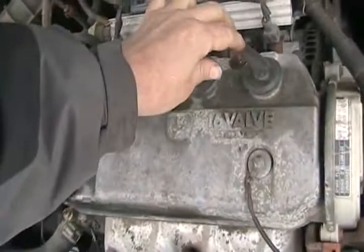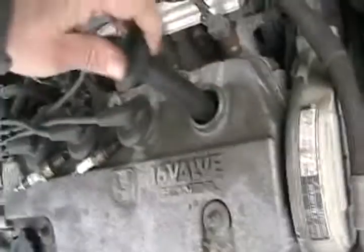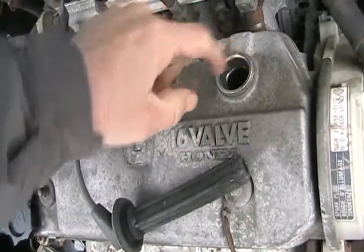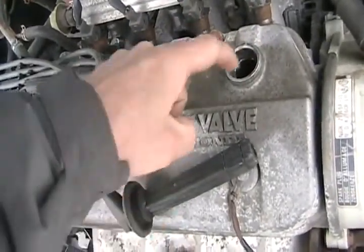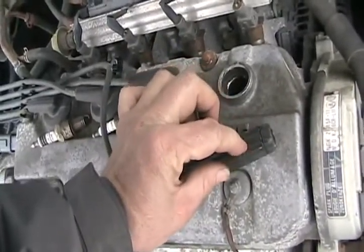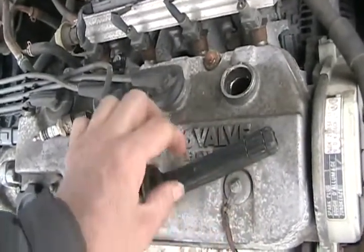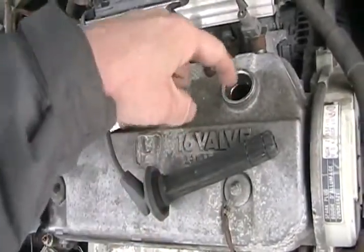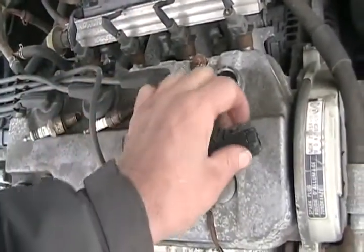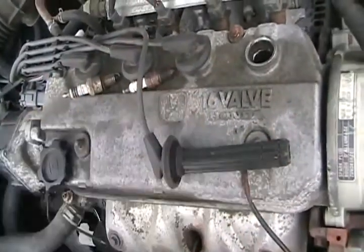On cars with semi-hemispherical or 16-valve engines where the spark plug wires are in the middle of the rocker cover, there's a gasket that goes around the rocker cover around the spark plug. They deteriorate over time and oil builds up in the spark plug hole. When the oil gets deep enough, it can actually cause a misfire. The best way to fix it without changing the rocker cover is to remove the spark plug, let it sit for half an hour so the oil runs onto the piston, put the spark plug back in, dry it off, and you might be good for another year. The proper fix is to just change the seal.